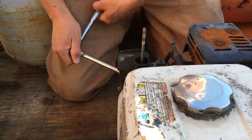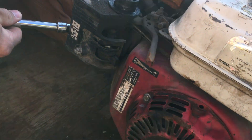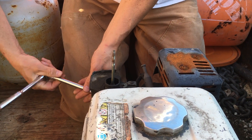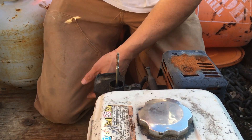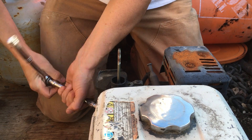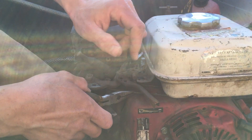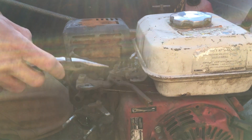This is also where the choke is busted — you can see it's no longer there, the piece of it is gone. And this is the actual governor spring that's gone as well. Same thing with the bracket that's holding the governor spring in — it all has to be reattached.